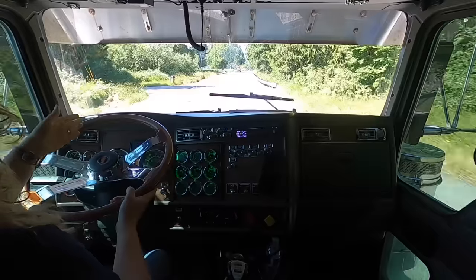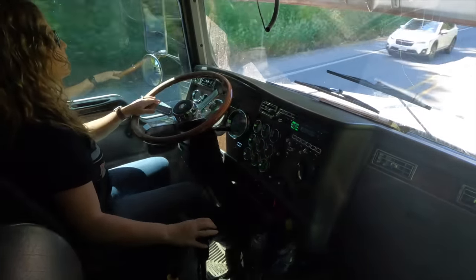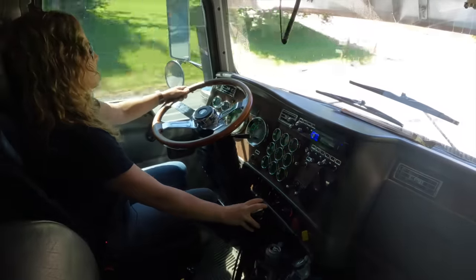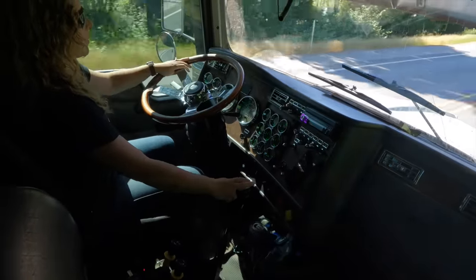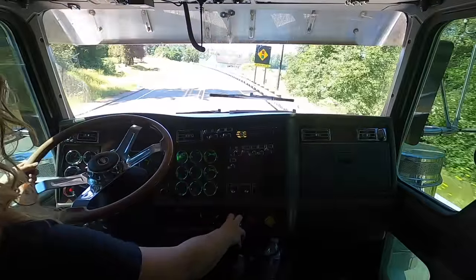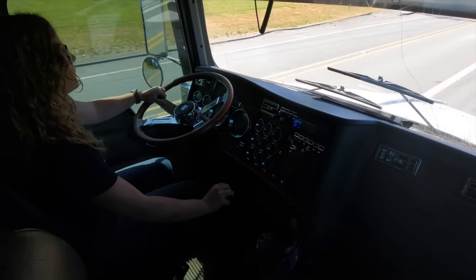I start slowing down right when I get to the top of the hill. We're in eight low — gonna drop to seven high, so I push the thumb selector up, pull it out of gear, put it towards seven, and rev it up slightly. Then seven low, I move the thumb selector down. It's a 40 mile an hour speed limit as you come around the curve before you can see the light. Going 41 — light is red — I'm gonna grab six low, five low.